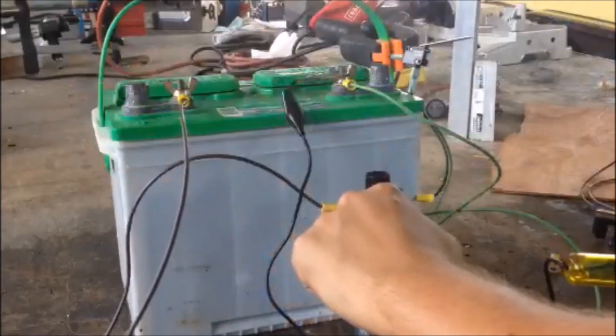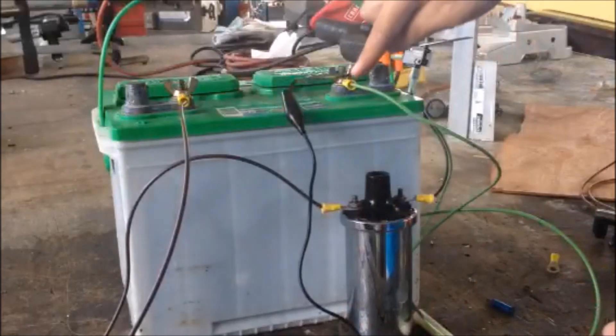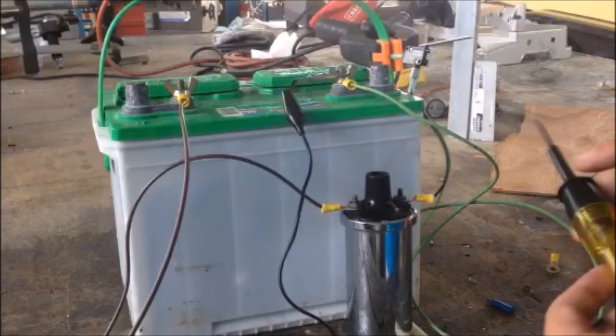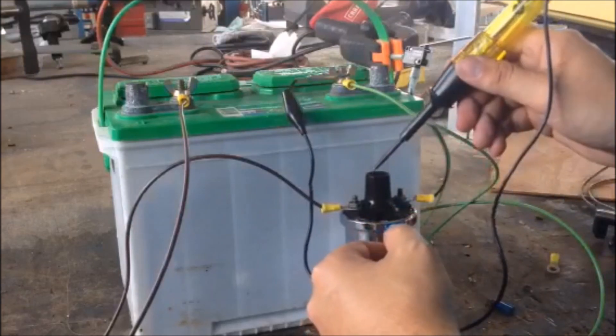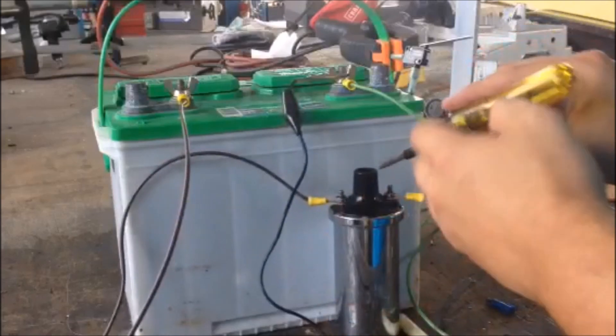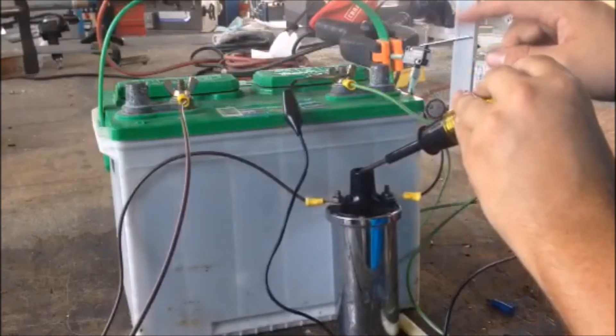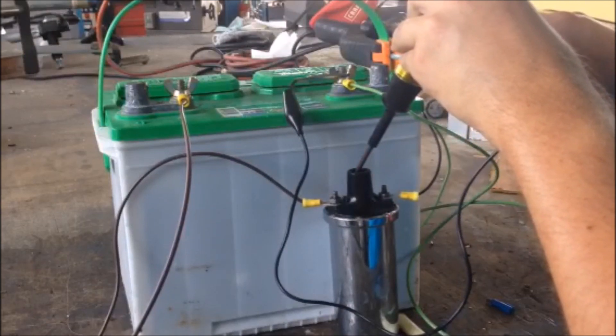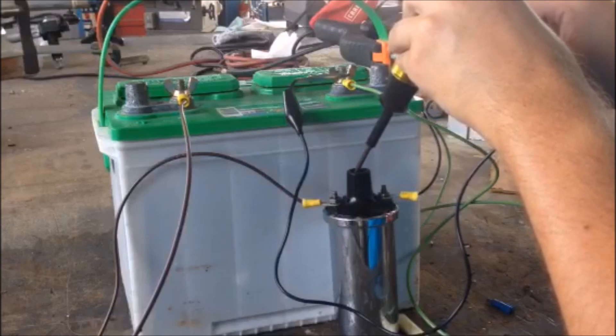This test light that I hooked up to the negative — I'll be putting it down on the output of the coil, and every time I touch my switch up here, I'll be creating a spark. Due to the camera angle, you're not going to be able to see it. But you'll see I'm holding the test light and you've got to get a gap, just like a spark plug. You don't want to just touch it directly — you want to create a gap. And every time I touch this microswitch, there is a spark shooting in this coil.